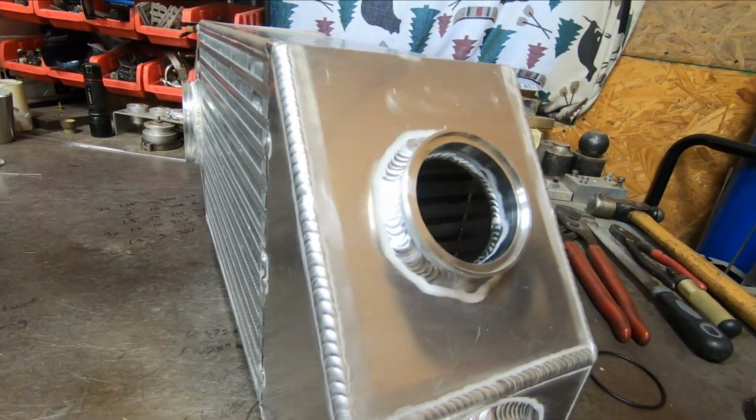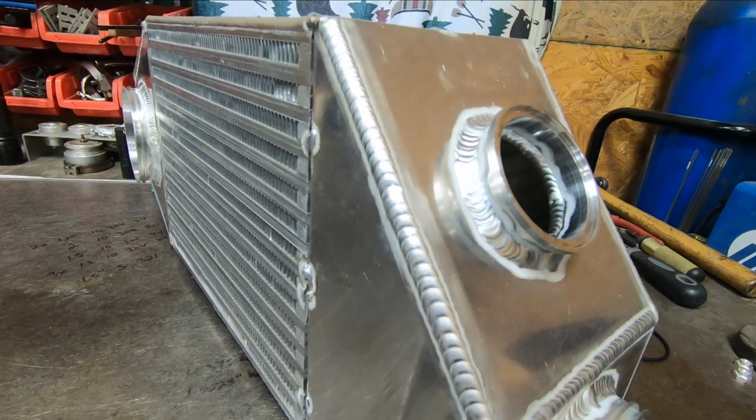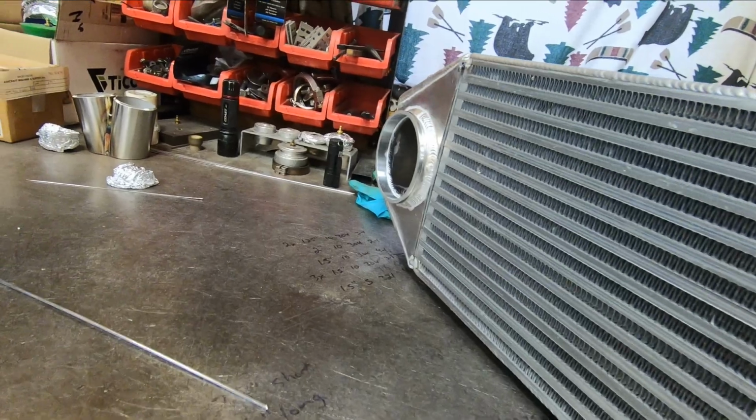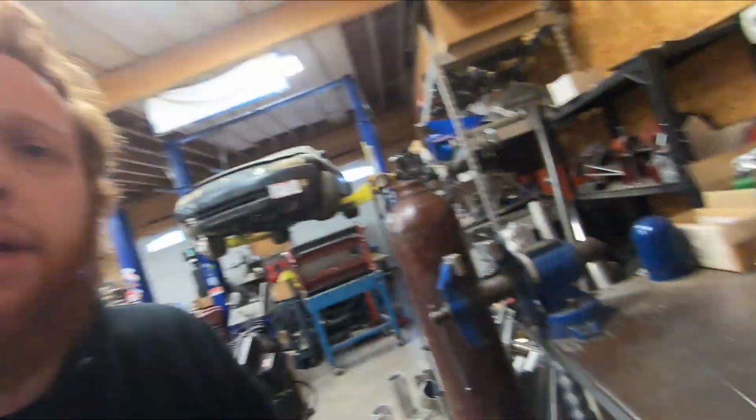There we have it. That nice TurboSmart flange welded onto the side of this tank. And you may have noticed that we have a Wiggins flange there and a Wiggins flange there. And in looking at it a little bit more, I opted to weld the coupling flanges directly to the tanks, as I think there will be enough room, and if not, then I can do some interesting things with the tubing to make everything work.